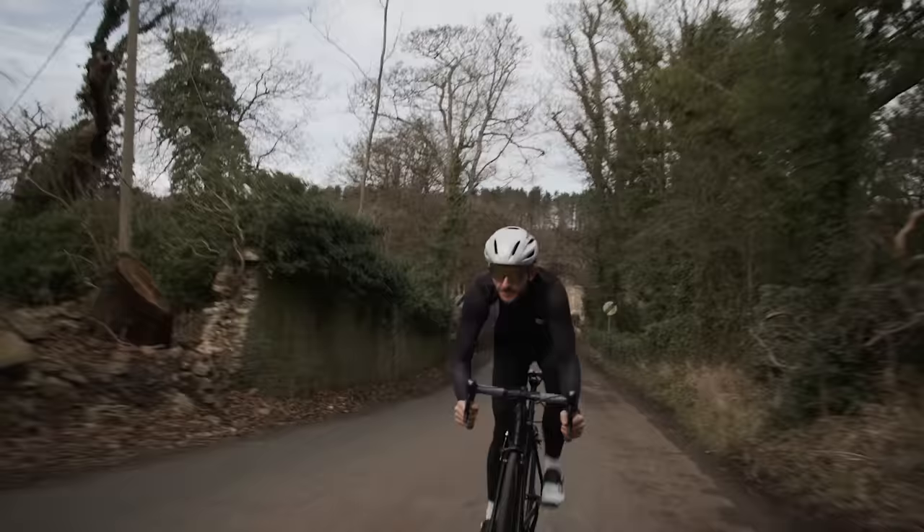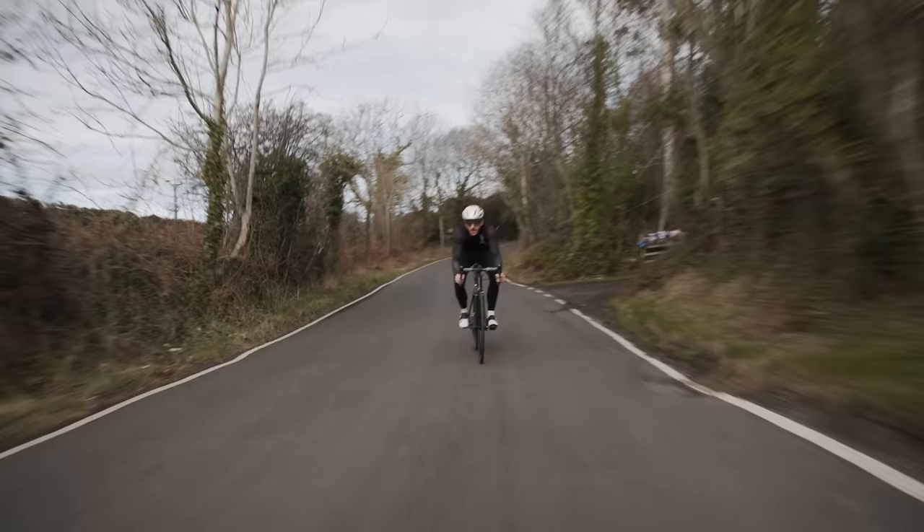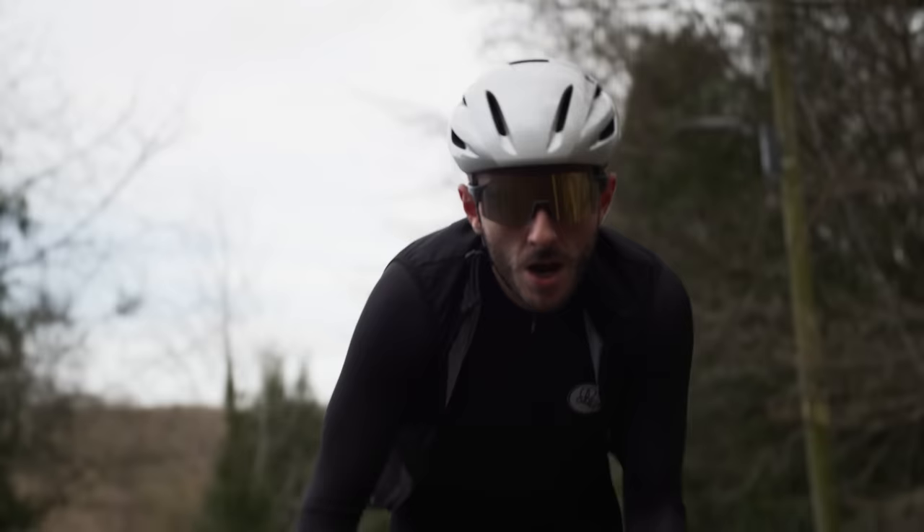With everything on it being very alloy, was it a harsh ride? No, not noticeably. 28mm nice supple tyres made a massive difference — tyre choice makes a massive difference in terms of comfort. If the frame and fork is a little bit harsh, bigger tyres at slightly less pressure at least masks it. I jested that it didn't have disc brakes because basically everything now has disc brakes. But I would 100% rather ride rim brakes at that price point, because mechanical disc brakes — unless carefully set up with compressionless housing and really good units — often aren't better on stock bikes. I'm happy with the brakes.